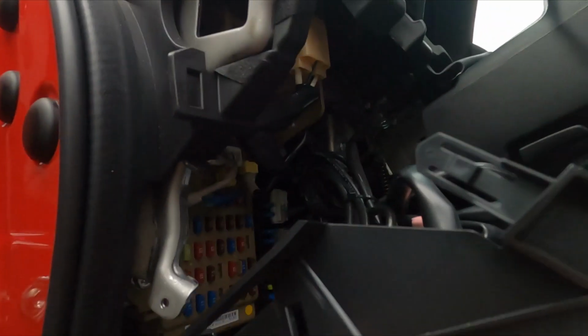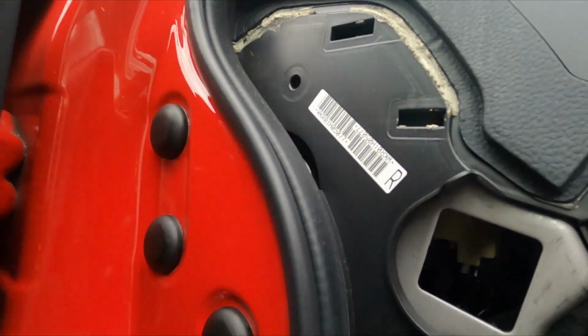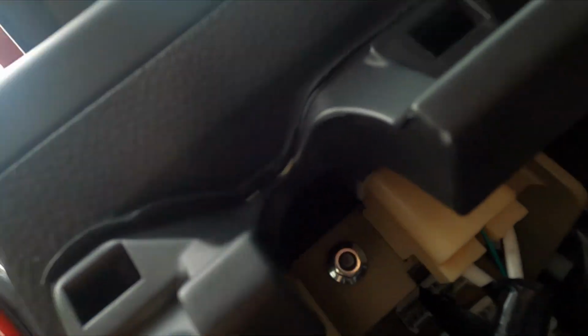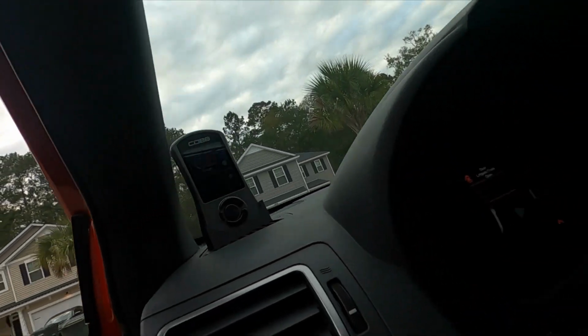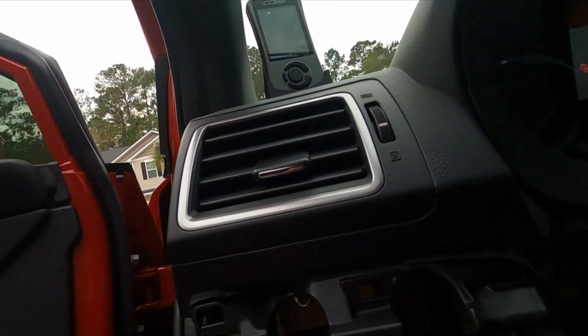There's one screw that goes in here, attaches it here, and then this has three clips up on the top where it just plugs in like that, and these right here go behind this rubber seal. What helped me, because you really can't see under here, is this: the AccessPort is plugged in, the wire is zip tied, and the wire runs up here. I don't know if you can see the light shining through. If you're having trouble seeing in there, you can try feeding the wire down and see where it comes out at the bottom.